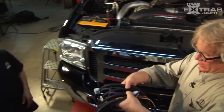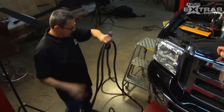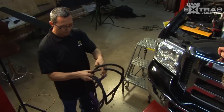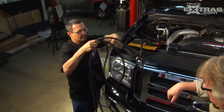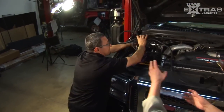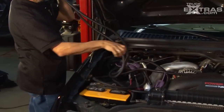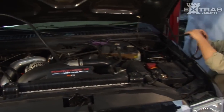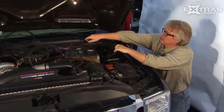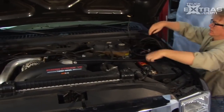Okay Jose, I got the wiring harness for you. On the wiring harness we've got several lengths — a longer one and a shorter one. Rule of thumb: the shorter one always goes on the side of the battery. That would go in this side right over here, just above that one right there. The longer end will go across the engine bay, down through the fenders on the inner fenders.